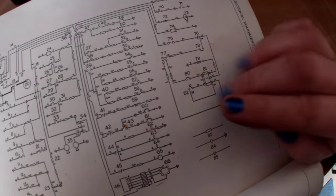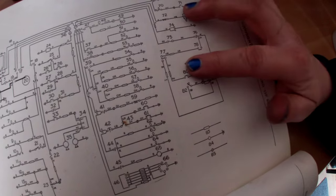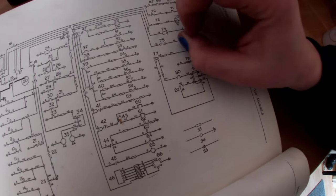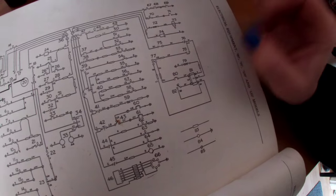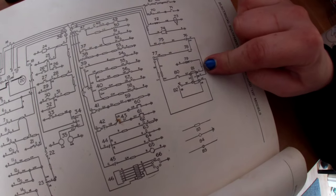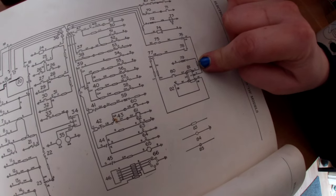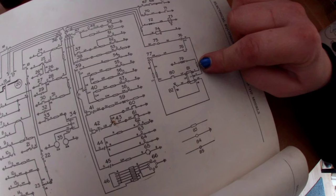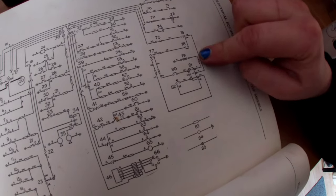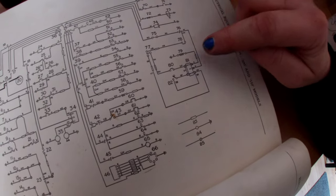Trying to check that all this was okay, whereas if I'd just gone straight under the car - which is what I recommend you do - it's easy. Jack up the passenger side, left-hand side, look underneath and you'll find a little cylinder attached to the gearbox with a little rubber boot on it and just one wire going to it. That will be your solenoid. Just above the solenoid there'll be a little bullet connector, so if you can get a probe in there and see if you're getting 12 volts.